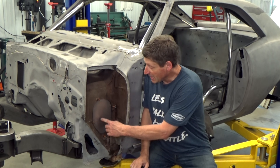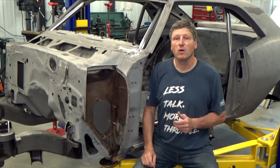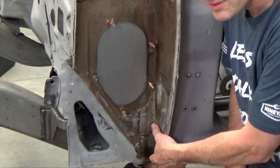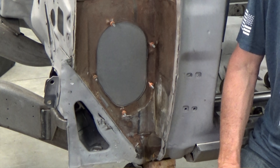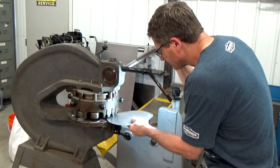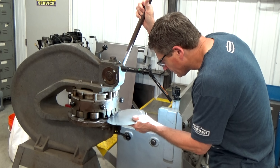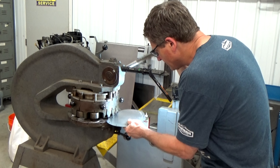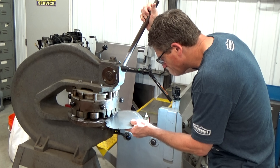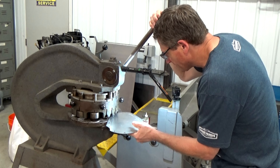I've got my panel made and fit into position. Now I'm just going to pull it back out, make some holes in it so that I can plug weld it from the inside, then make another patch to close out my rocker panel. I'm making 7/32nds plug weld holes every two inches. This is only 20-gauge steel, so anything around that quarter-inch mark for a hole size is going to be fine for this thickness.